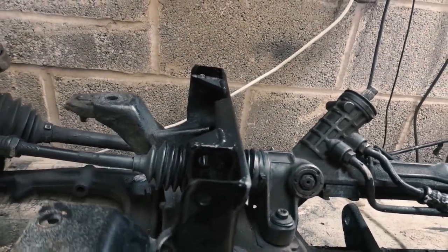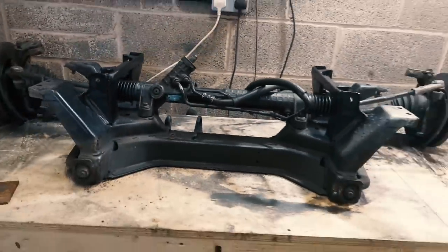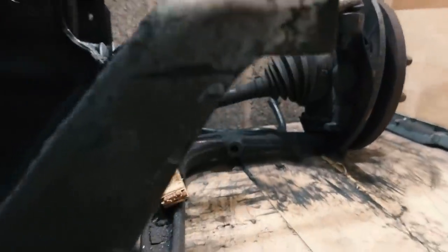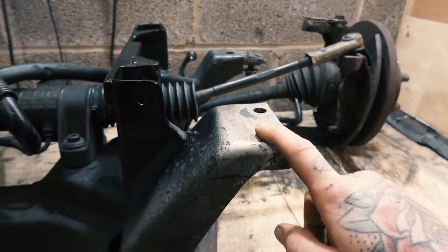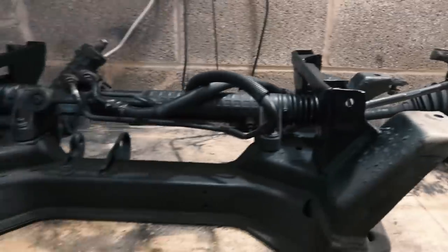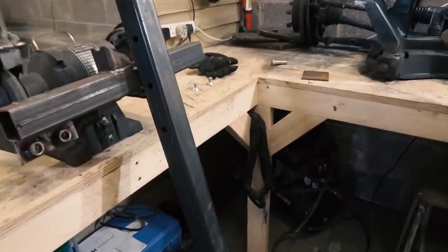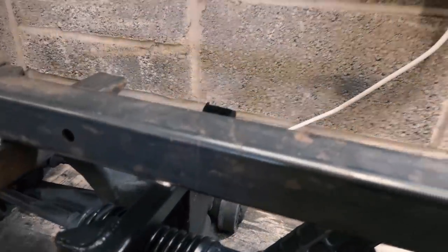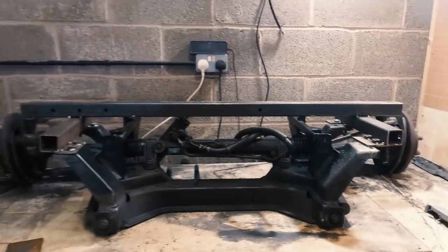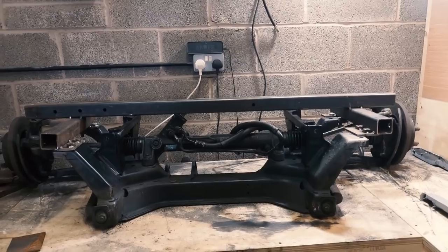I should only have to notch for this small bump in the top arm. So today we are, if you can see the mark, gonna cut 30mm out of the subframe mounts to raise that subframe off the floor. And luckily, our good man Jord has made a jig. So I can cut that out and hopefully weld all the mounts back in the right place.